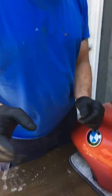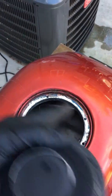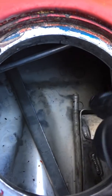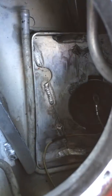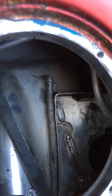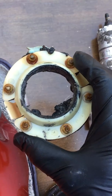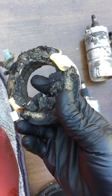We'll show you how to lift up the fuel lid, remove the screws, and down inside the tank there's one connection that goes up to the fuel filter and up through to the fuel pump, which goes into that well. You have to remove the electrical connections. Our fuel pump went bad, and additionally from sitting, the vibration damper for the pump has rotted.